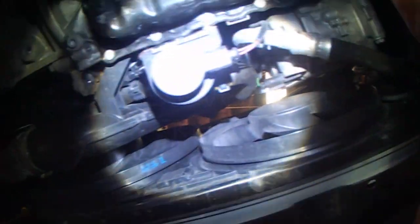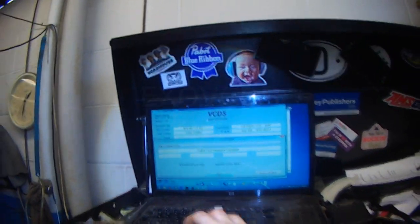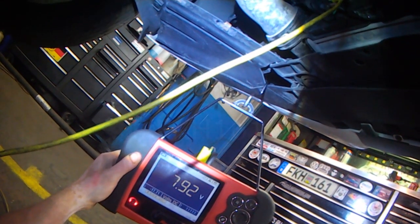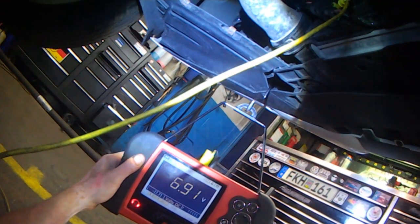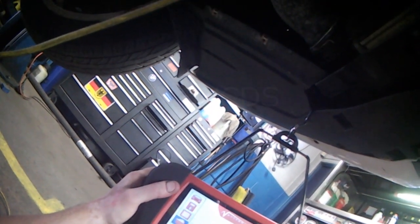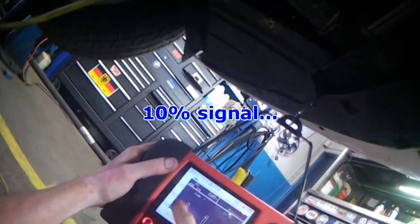Now they're pretty much off and they're going to speed up again. You can see here there's a voltage of 6 volts, 7 volts, 8 — and then it's going down to zero again, close to zero. It's a pulse modulated signal; if I had a different scale where I could measure pulse width you'd be able to see that. Let's just change that over and leave it on 20 volts so you can see the pulse modulated signal.